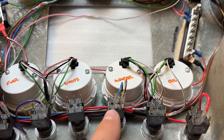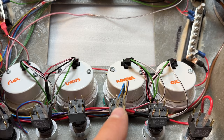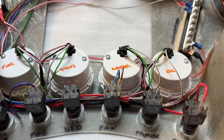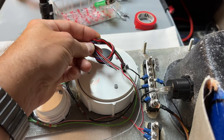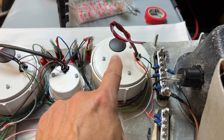I do suggest maybe a little drop of solder on the Savage switch terminals because you're going to have to unplug them all when this dash goes off to the trimmers. A good crimper, definitely, plus a little drop of solder just to make sure those wires stay in — some of them are a bit fatter than normal and you still need to get two into the crimp. I'll probably keep those wires uncut until I know I've had a successful start and everything works, then cut them shorter and put some heat shrink on. That's the rev counter sorted.